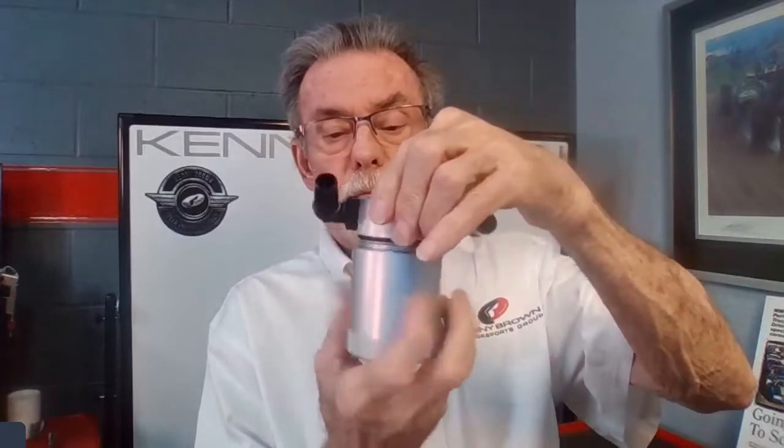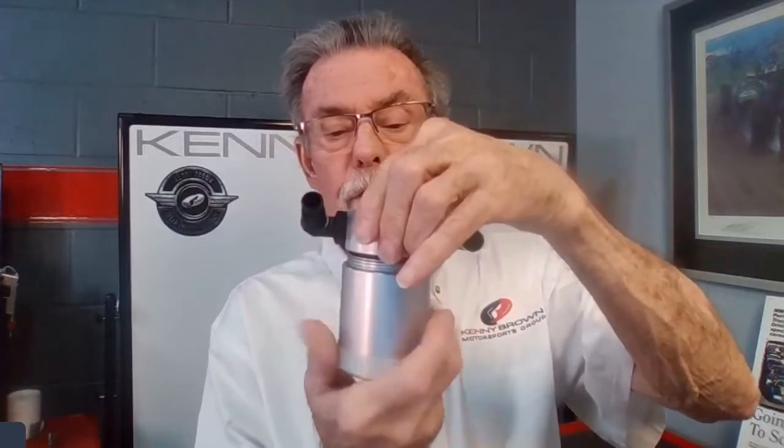What it does is it's got this little container down here — it unscrews. You mount it like this and unscrew it. After you first put it on, you want to check and see how much oil is in there about every day. After a couple of days, you can figure out how often you have to empty it. As the oil comes through, it gets trapped in the bottom. This is a filter — this is where the oil comes in, and this is where it goes into the intake. It traps the oil and keeps it from going into the motor.